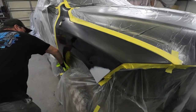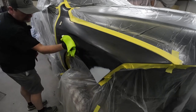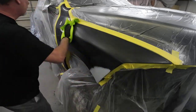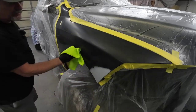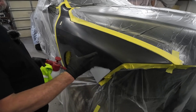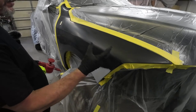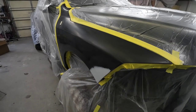This particular vehicle has had some dressing put on it — armor oil or something under the hood — since he had just purchased it from a dealer. I want to make sure this is clean so we don't have any fish eyes or reaction when we apply our base and clear coat. I'm wearing gloves so I don't transfer any oils from my fingers to this panel. Now that we have it all washed, we're going to use a tack cloth.